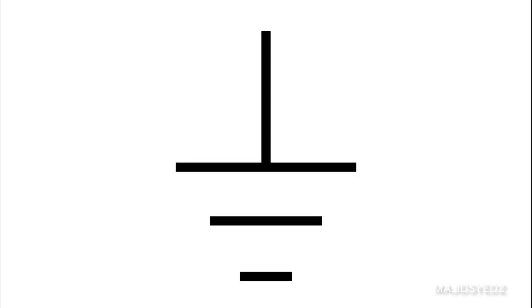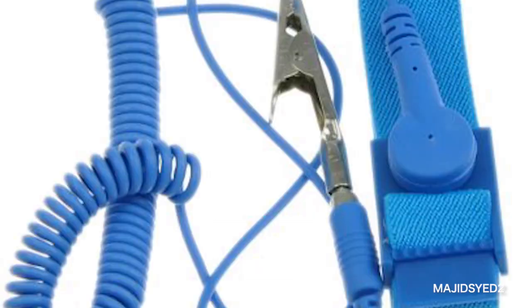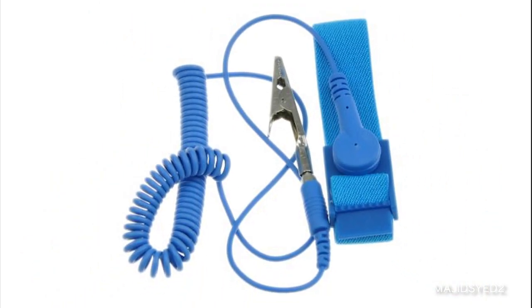So now we're ready to actually put everything together. Before you touch any kind of electronic equipment, it's important that you're safely grounded so you don't have any electrostatic discharge on sensitive electronic pieces of equipment. There are a number of ways you can do this. One method is just touching a metal part of your PC case connected to the power. Another great way is purchasing an electrostatic wrist strap, which is basically going to prevent any static electricity transferring from your hand to any sensitive piece of electronic equipment.